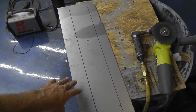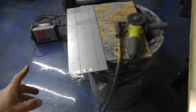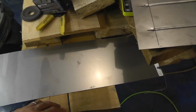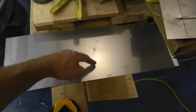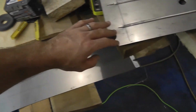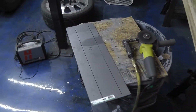So I'm gonna go in and cut it out, and then what I'll do is I'll get them positioned in and I'll get both corners installed. Then I'll lay this piece in there because I might have to cut a little bit off of it and trim it out. So what I'm probably gonna do is I'll roll the flange on each end of this, and then I'll roll the beads in it, and that way I can sit this one over last and just let it go over top of these two panels. I think that's gonna be the easiest way.